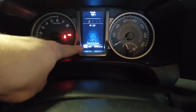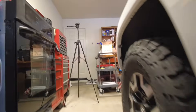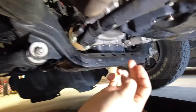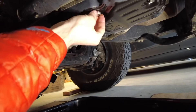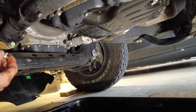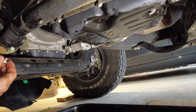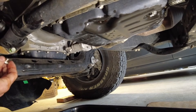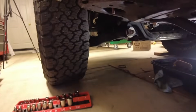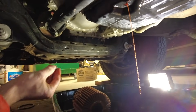The D is solid, so let's go underneath and check — let the fluid drain out of the check plug. Be extra careful because it is hot. No fluid is coming out, so I have to fill it up again because all the fluid is now circulating through the entire transmission and nothing's coming out — we are a little low. Note to self: don't put everything away the first time because you might have to add more fluid.